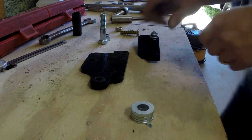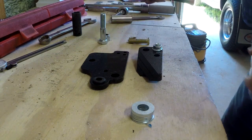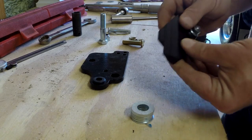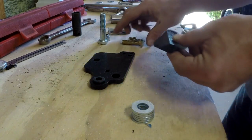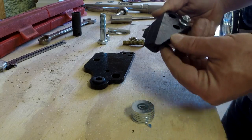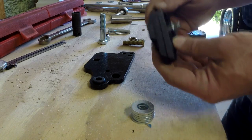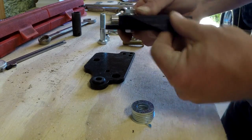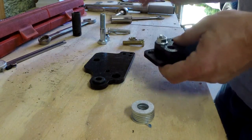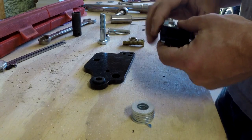To make things a little quicker, I've got my parts laid out here. You're going to get all of this times four, but to simplify: you get four wedges, and a whole bunch of washers. These wedges are all different — the middle one has four holes, this one has three holes, and the bottom one looks totally different. You stack these up, they make a nice wedge, put this bolt in, and tighten it to 20 foot-pounds. If you don't have a torque wrench, don't sweat it — just get them good and tight with hand tools.